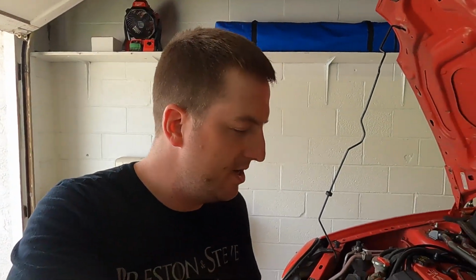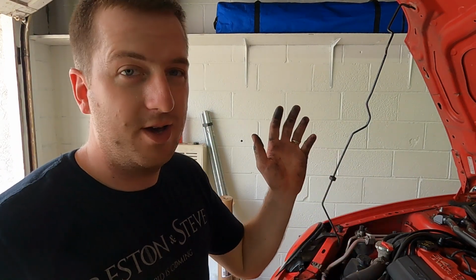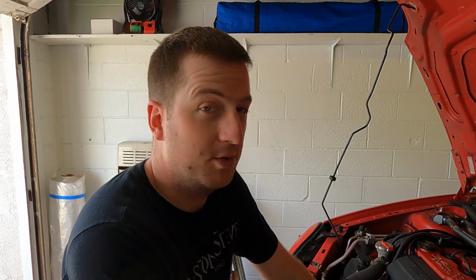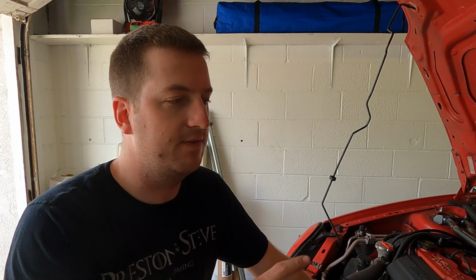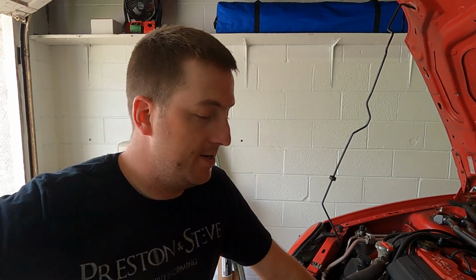It's not real bad. It's definitely leaking, but it's not big enough or fast enough to create any sort of issue, especially not a crazy AFR gauge reading. So I think we're good on the boost test. I'm going to go ahead and throw the intake back on, clear the code, and start the car to see if it idles the way it should. If it does, I might take the car out for a test spin just to see how it handles.